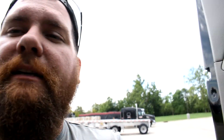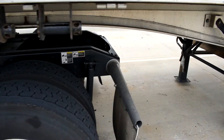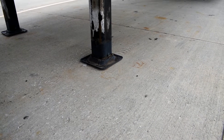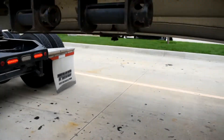Now we're back on the driver's side. He's getting into the truck and he's gonna start it. In our TMC trucks you can dump the airbags in the back — the button is labeled 'air suspension dump.' He's gonna pull forward about a half a foot to a foot, just enough to confirm the fifth wheel is disconnected from the pin without fully pulling out. Then he hits the air dump suspension button — it takes about three seconds for the air to completely dump — and you'll notice the landing gear now touches the ground. Then he pulls forward completely out.